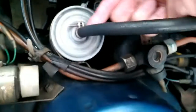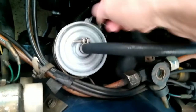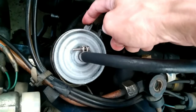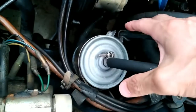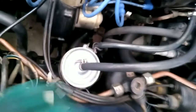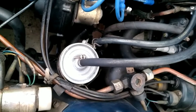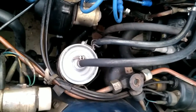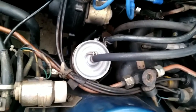We're going to remove this with a Phillips head on the hose clamp here, and then we'll loosen this bracket with a 10 millimeter socket. Underneath there's another clamp just like this one to remove. We're going to use a rag to soak up any gas that might come up when we disconnect the hoses, and I'm also going to have a small container to catch any fuel that drips out of the filter.